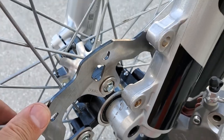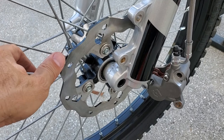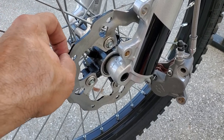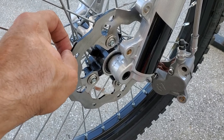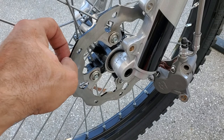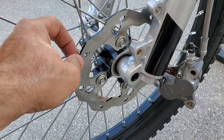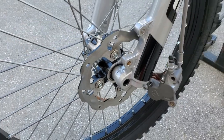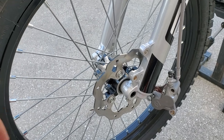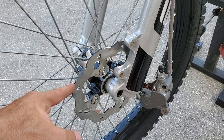So you're going to feel a little rattle on your Electric Motion Escape, or maybe some other bikes too, with this type of design. When you go to wiggle that wheel back and forth with the brake set, you'll hear a clickety-click. It's obviously deliberate, and it's not a bad idea because it allows the disc to float between the brake pads and never do that rubbing. You know how you spin your bicycle or motorcycle and it kind of goes shoom-shoom because it's rubbing? Well, this is just going to float right down the middle, which is nice — a couple millimeters this way or that way.